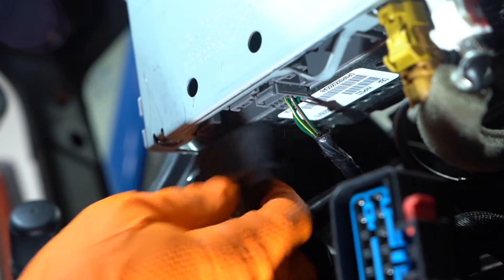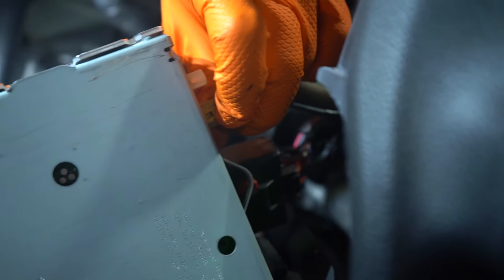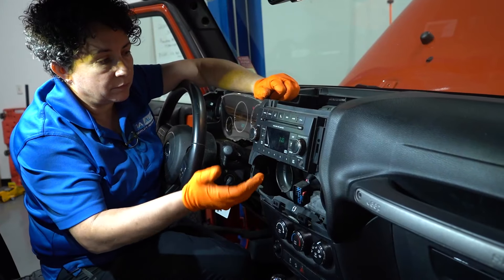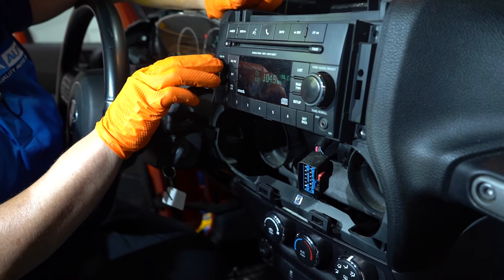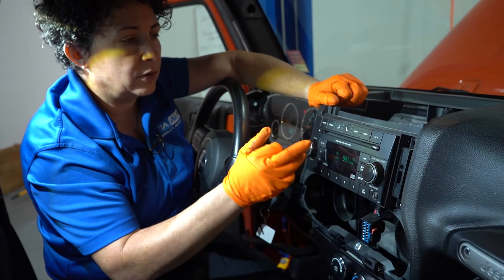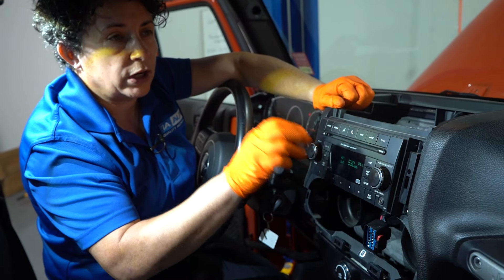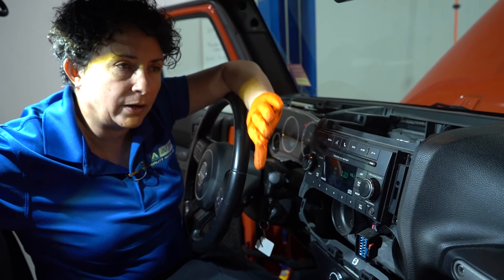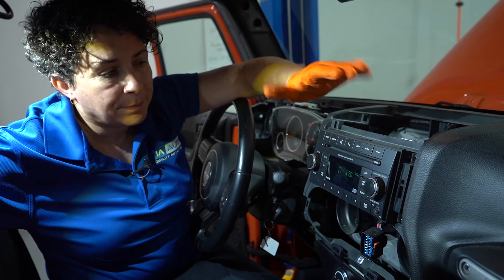Here's the tab — push in on it, pull it down. Same with this one. Now I'm going to plug it back in. It's been disconnected for about 10 minutes. Let's turn it on and see if it's the same or if it's corrected. It didn't work. You can see I'm turning the volume dial — no volume. Memory still works, station numbers are still programmed, it shows AM, FM, satellite — but it's still not working, just a snapping feeding through the speaker. The TSB does say amplifier volume not working and amplifier clicking noise, which is what's happening. I tried to unplug it to reset it that way — didn't work. Not just a battery reset, but an actual item reset, because there's a circuit board in here. It works sometimes on GM cars with body control modules, so I thought it was worth an effort.